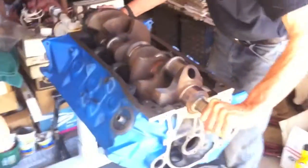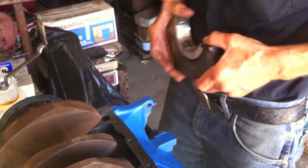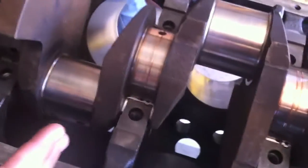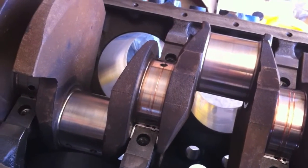It's hard not to laugh, isn't it? There it is. I'm getting excited. Now we do the same thing with all the bearings — bearing caps are in the box. So this is a flange right here, wheels — this is your thrust bearing, thrust bearing number three, and it is going on right there. The thrust bearing basically doesn't let the crank go forward and back. Is that what it's always called? Yep.